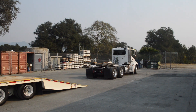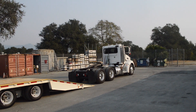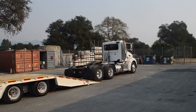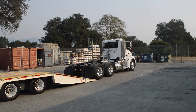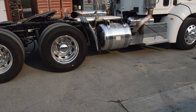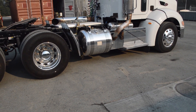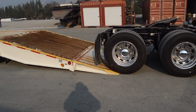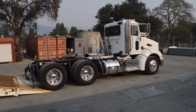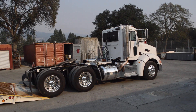We're loading this truck on first. It's got a 180-inch wheelbase and it's nine feet seven inches to the top of those horns tall. We're loading it backwards. What you've got to watch out for is this tank is only 12 inches off the ground — make sure you don't hit it on this pivot point right here. We're loading on this one first.